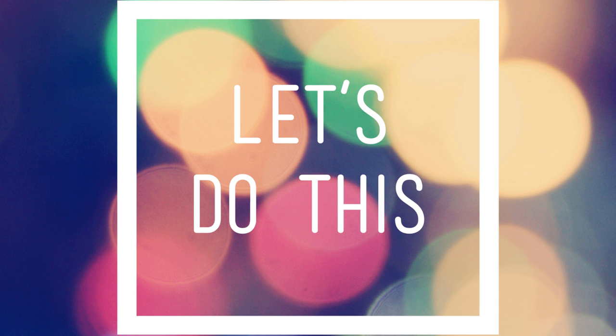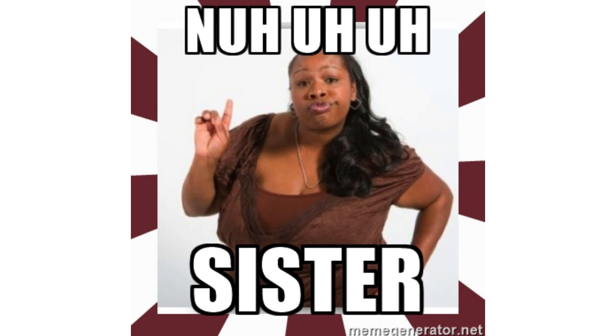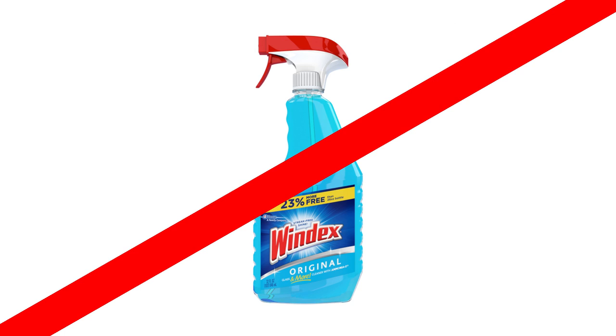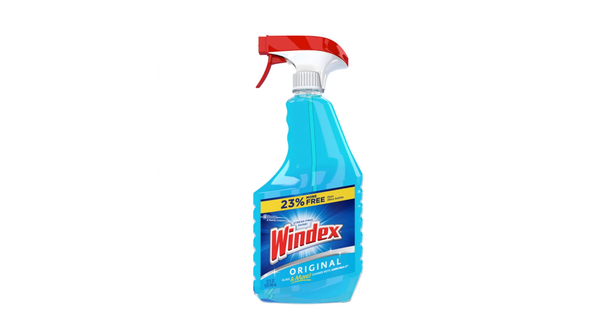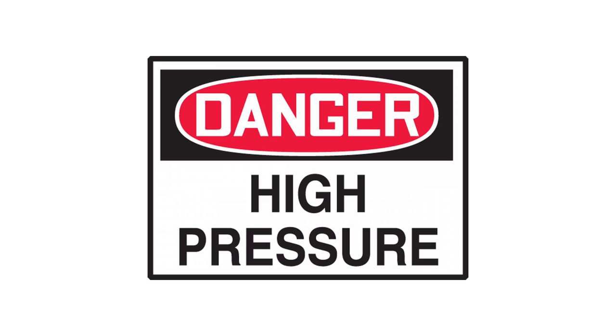So you have the tools, you have the determination, but how do we clean it? Here's what you shouldn't do. Don't use window cleaner — please don't — or any other alcohol-containing substance, and that includes isopropyl alcohol, because they may separate the different layers of your screen. Don't clean the monitor while it's plugged in and don't press down on it. You may warp it or even break it altogether.